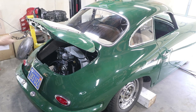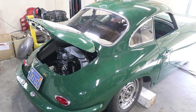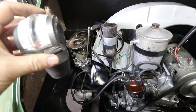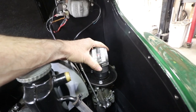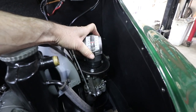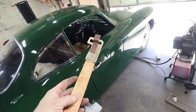I'm going to let it warm up a little more. I just drove the car around the block, but I want to put more temperature in it to make sure everything's stable with the linkages. The engine's nice and warm. The synchrometer is showing about four on this side, a little bit less than four but close on the other, and four, four across the board — all pretty equal.